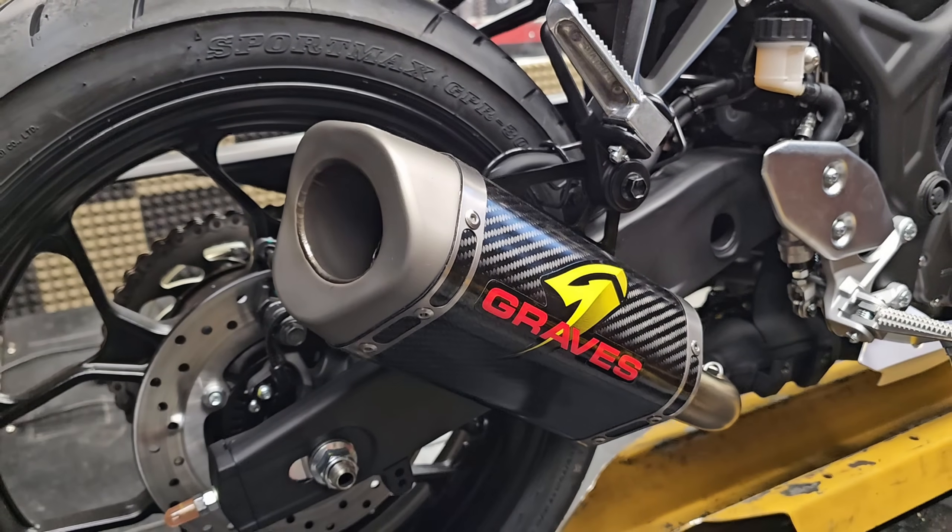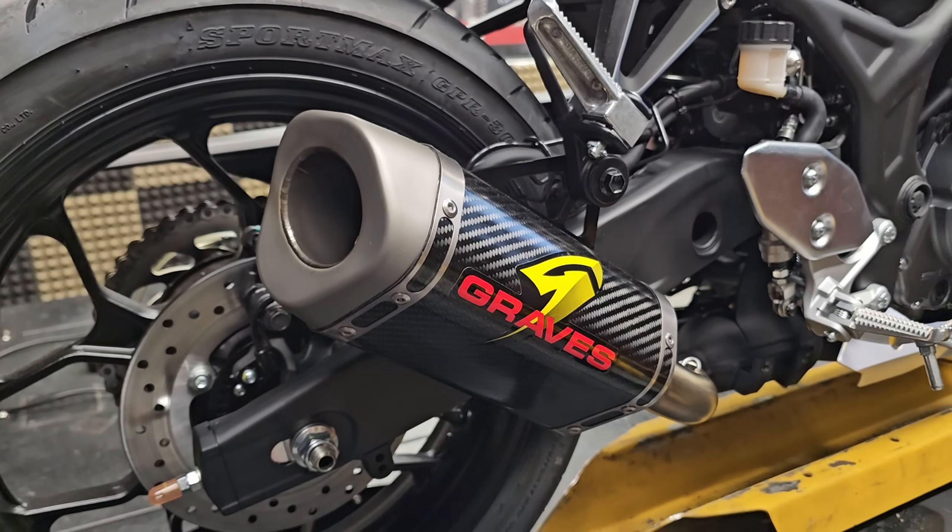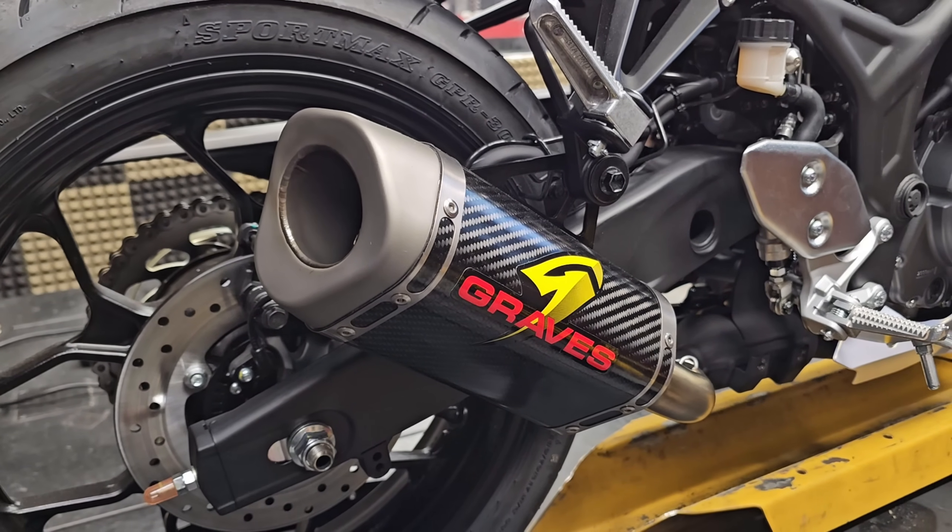Now a lot of people looking at that AFR chart are probably going, that's nuts — it's just a slip-on. It shouldn't make that big of a difference. The bike has O2 sensors, why isn't it trimming? I have explained more times than I can count that the narrowband O2 sensors used on almost every single modern motorcycle are the same narrowband O2 sensor technology that the automotive industry abandoned over 20 years ago. They are not capable of making any sort of accurate fuel trim, especially anywhere past very light throttle and low RPM ranges. And this huge diameter change in the muffler does not only affect wide open throttle — in fact, things are even worse at light throttle.